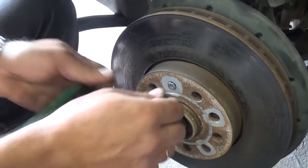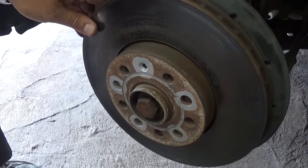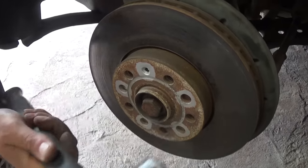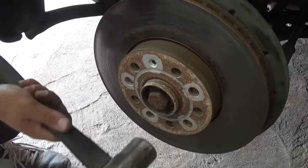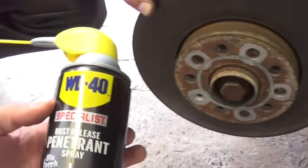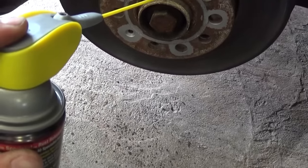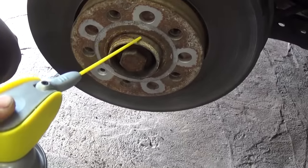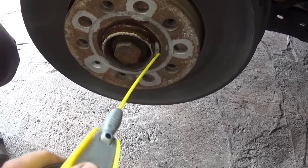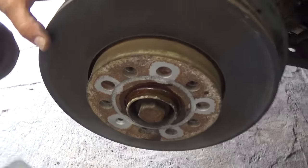Some bolts are with a screwdriver, some are with an Allen wrench — really different kinds. This one will be stuck really good. If it's really stuck, you can use a penetrating spray like PB Blaster to loosen it. Spray where the rotor and the hub contact and let it soak for a little bit — I guarantee it's going to come out. Sometimes rust will make it stick.